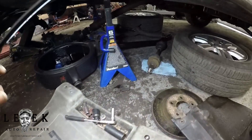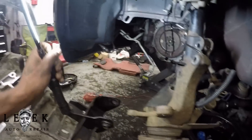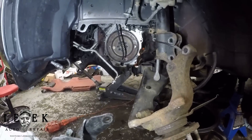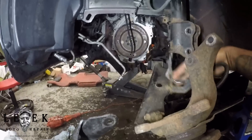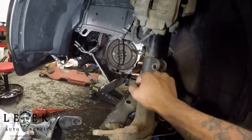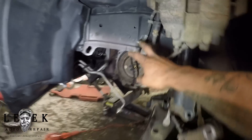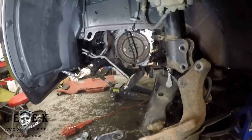I took out the axle — here it is, the driver's side axle right there. This ABS wire: definitely make sure you get yourself some slack. There are a couple of 10mm bolts holding it in. Make sure it doesn't get tugged, or you will be experiencing ABS lights and whatever other problems — it's going to cost you money. There's a little C-clip right here, and another one placed in between for the brake hoses. Make sure you get that off and get yourself some slack. Once you have slack, you're set up to get the axle out — go ahead and tug it out, and the axle comes out no problem.